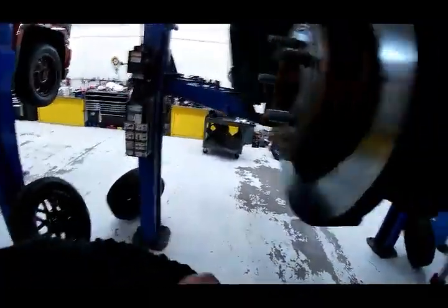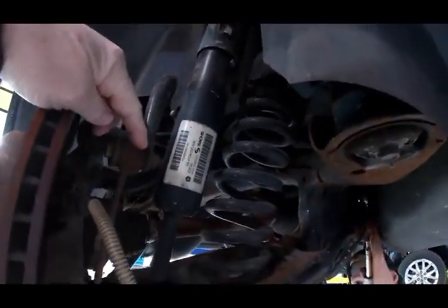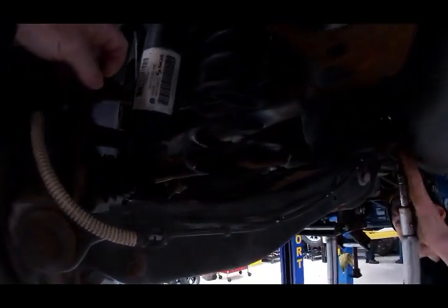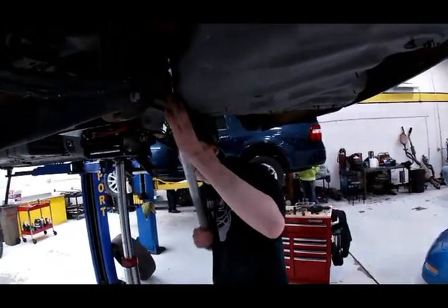So you've got a possibility of not dying in the rain. But the problem is the rear sway bar is a little high. We're going to take this out - here it is right here. You can take and cut this and remount it down lower. We're just going to get rid of this whole thing to make it go away, because we don't need the weight. We're working on kind of a drag car.